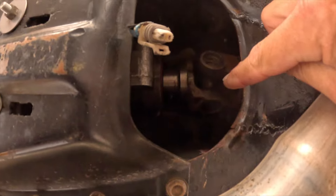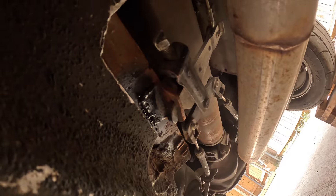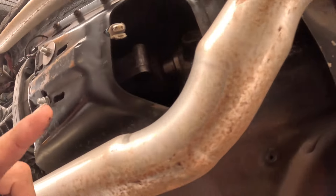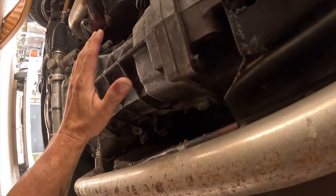So I need the drive shaft out of the transmission — not a big deal. But I gotta pull the drive shaft apart over there. I've got this emergency brake thing in the way, I've got exhaust in the way, I've got this shield thing in the way, before I can even get down here to this section. And this is where I need to be.